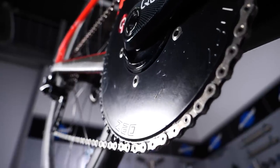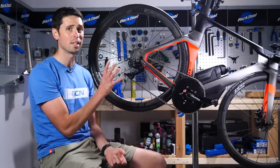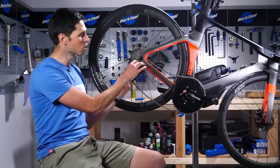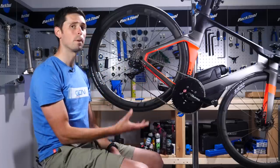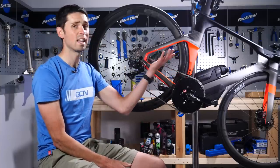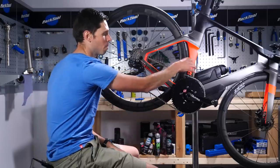Your bike is now set up with a perfectly adequate one-by system ready to go. Give everything a quick check over and make sure it's running nice and smooth. For the most optimal setup, there are three other things to consider. First, if you ride on particularly rough or loose terrain, it might be worth considering a rear derailleur with a clutch unit — this controls the lower cage to retain the chain more securely. Second, a chain keeper or chain retention device goes in place of the front derailleur to hold the chain in line with the chainring, though you will lose some of those aerodynamic benefits by adding a component back.